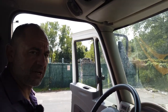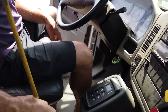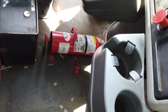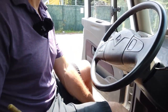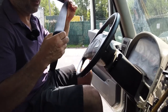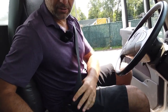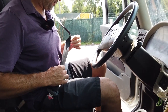We're going to start the pre-trip inspection inside the cab. First, check the floor: should be clean, no debris, no foreign objects under the pedals. Seat for the driver: should be properly adjusted and feel comfortable. Seat belt: mounting secure to the wall, no missing screws. Condition of the seat belt: no cut or ripped. Lock: on, off, on — working properly and properly adjusted to the driver.